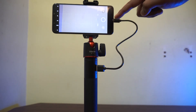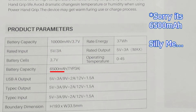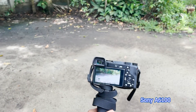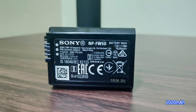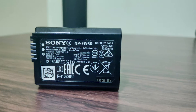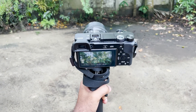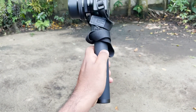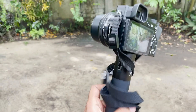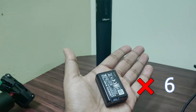It has a rated capacity of 10,000 mAh but for actual use you get around 6,800 mAh. Consider the Sony a6100 camera which has a battery capacity of 1,020 mAh — on average it gives around 80 minutes of recording time. By using this grip you can extend its shooting time by 6.5 times, that is 8.6 hours, provided the camera doesn't overheat. That is equivalent to carrying 6 spare batteries.